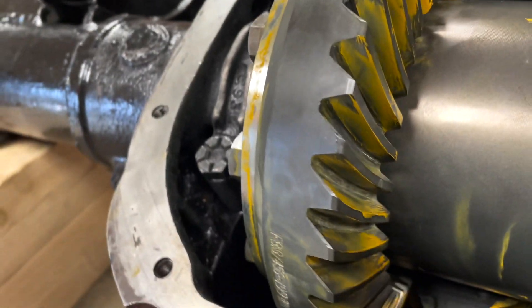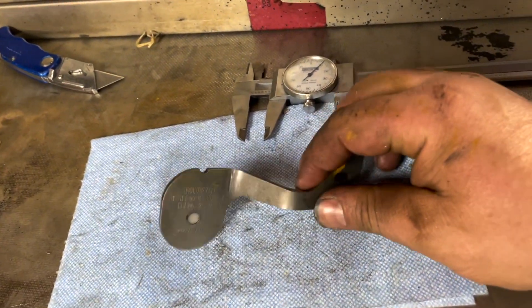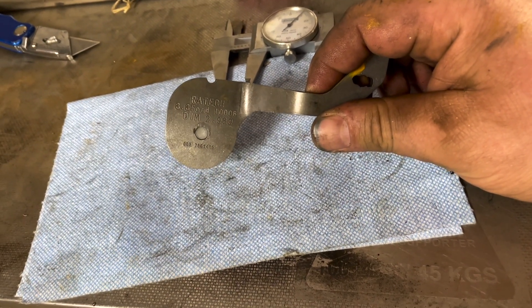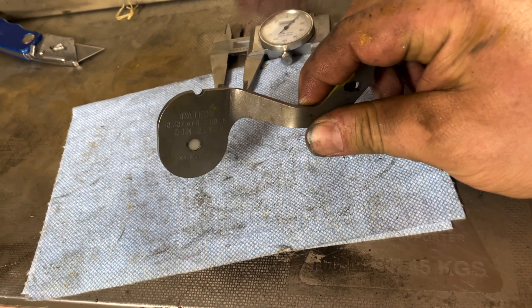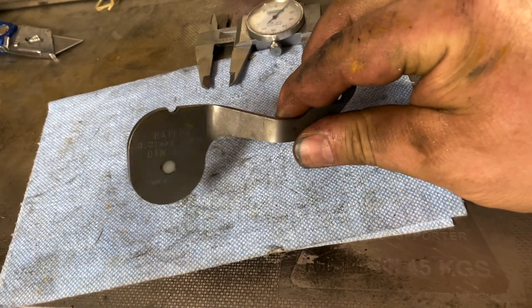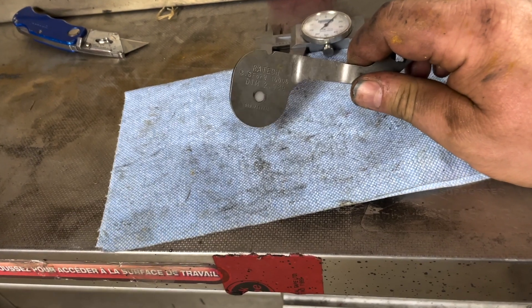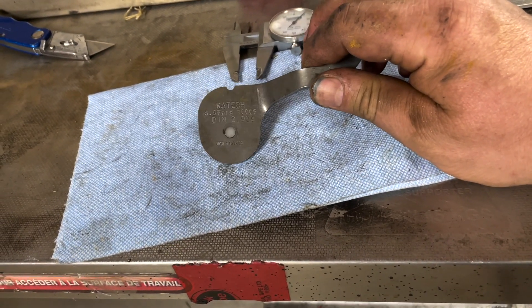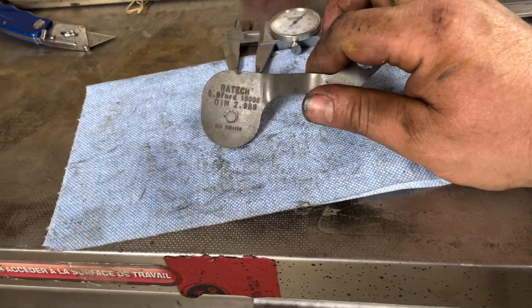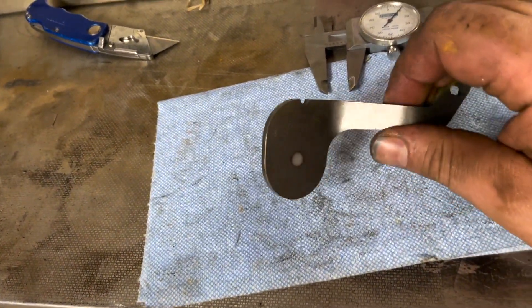You can see where it's transferred over there. In the end, once I figured out the calculation, it got me close — only 0.005 out, which isn't a huge deal. That could partly be because I was using setup bearings and not the original bearings, but you really don't want to be pressing new bearings on and off and risk damaging them. So this tool came in handy. I hope you guys enjoyed the video — if you have any questions or comments, post them below and I'll see you in the next one.